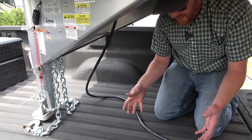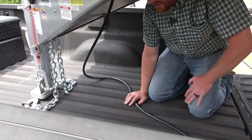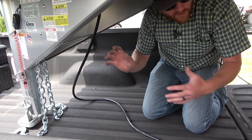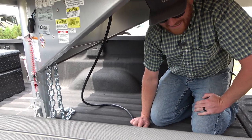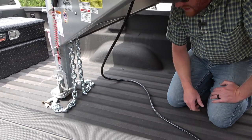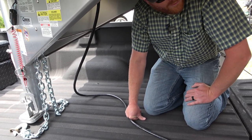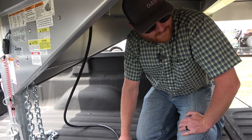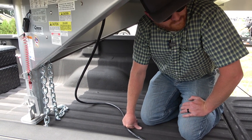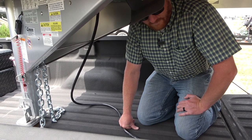With the newer puck systems in trucks, the safety chains hook farther back, and chain length is another thing we've got to worry about. We want some slack — not too tight — because when you turn you create tension on those chains. The snaps on puck systems are a little bulkier, so you might need a bigger hook to fit. I wish manufacturers would put longer chains on both goosenecks and bumper pulls because things are changing — adjustable hitches make things longer, and puck systems require longer chains too.